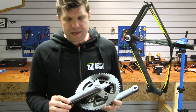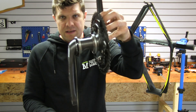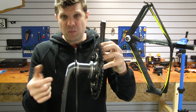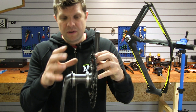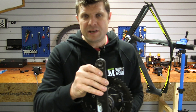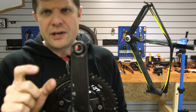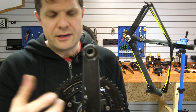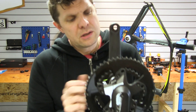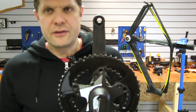This is a set of cranks called the ZED cranks. These are fascinating because they're actually made as one piece of carbon — just think about the engineering that's gone into that, where the torsional forces go and what you've got to bond to what. They solved some interesting engineering problems with crank length by making a little three-sided nut that goes in the end, so you can definitely adjust the crank length. It's a set of cranks you buy once. The chainring bolts also come in two sets so you can fit either 110 or 130 BCD chainrings, making it really versatile.